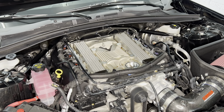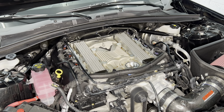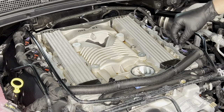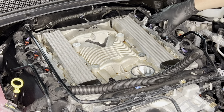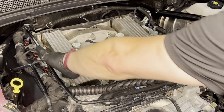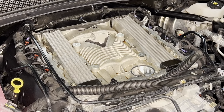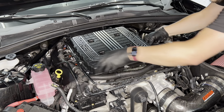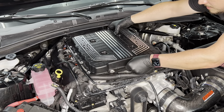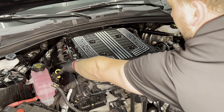We are at that point where it's time to put the supercharger lid back on. It's really a no-brainer — it goes back on only in one direction. Obviously, the lettering is going to face you. However, there is one thing to be cautious of: the injector wires here can get caught under the lid as you're trying to put it on, so I recommend just bending them back and out of the way until you get the lid all the way on. Same with the front harness, the rear harnesses, etc. Lid goes back on — there is a gasket on there. The gasket's reusable; you do not need to replace it for this work. Line up the holes, it'll kind of seat itself. Make sure none of the wires are pinched.